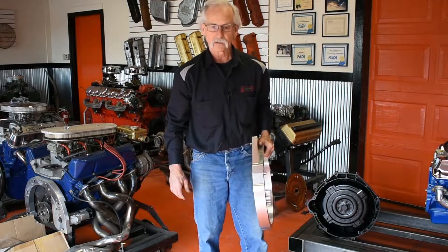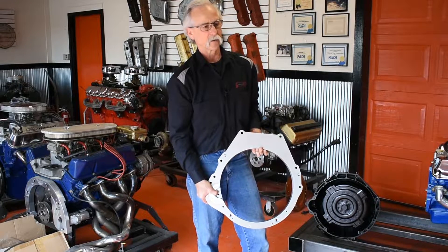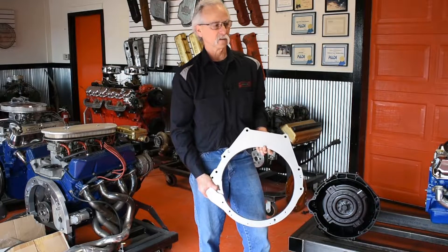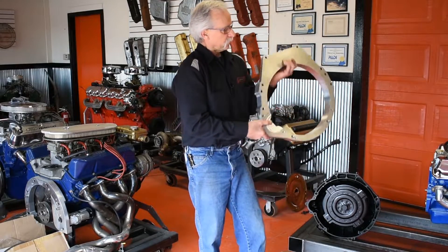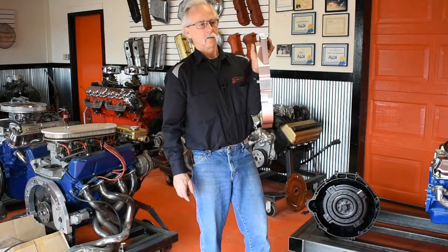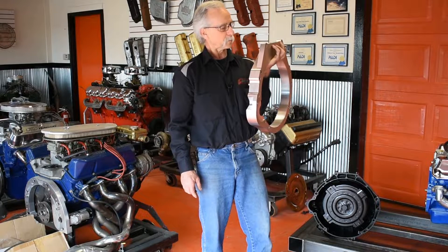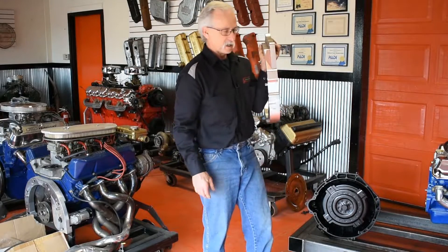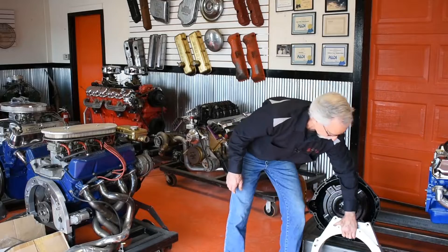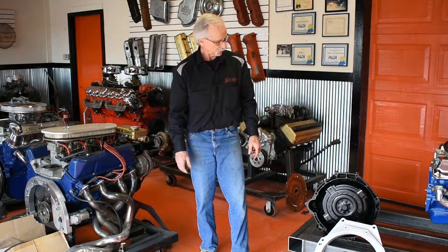I know I'm going to get a lot of pushback — why does it have to be so thick? It has to be so thick because the starter would run into the case, and another kit on the market requires a bunch of grinding. There's no grinding involved here at all. It's a really simple install with very few tools needed. The way we have it cut and the way the 6R80 bell housing is profiled, it isn't much different than what a C6 would look like on the back of a 460. Because it's stepped down with the smaller case, it really doesn't take up much more room than a stock C6.